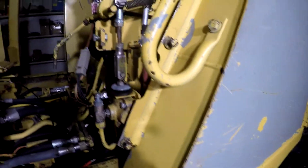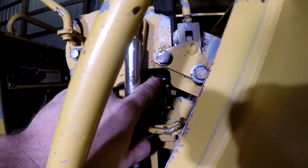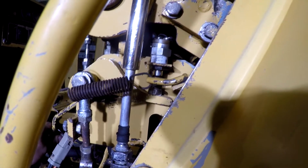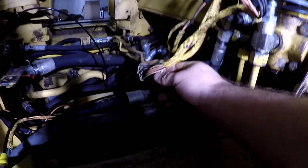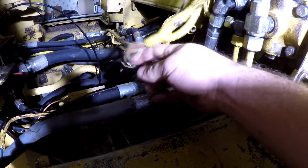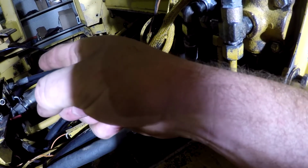And what I figured out is there's a black wire right here. You may be able to see it back there, right behind my finger. That goes to ground. It's grounded to the frame of the dozer down in here. And whenever you flip this up right here, you see that bolt, how that works, comes off of that switch. Whenever you flip that up, it grounds across. There's another terminal back here and another wire back there that you can't see. But there's a white wire right here that it grounds, and it comes right here where I got this bare spot in the wire. I took off some insulation with a razor blade there so I could do some testing. But anyway, this white wire goes down through the engine harness there, and it goes over to the brake switch that's on the service brake, down on the bottom of it.